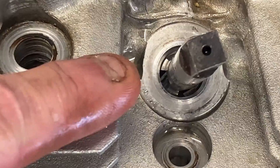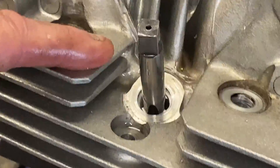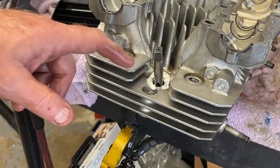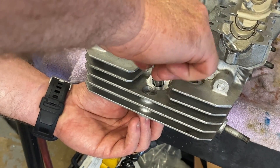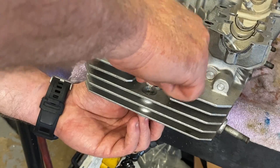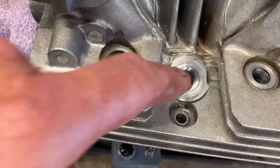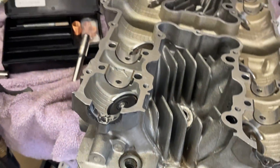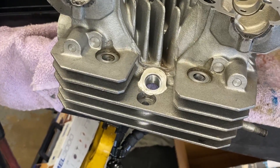You can see there's now a circle around the hole — we have contact on that outer surface. That's proof that your gasket surface for the spark plug is now where it needs to be. We can go straight through with the tool and take it out that way. There's your hole with the counterbore and the touch around the outside surface for the gasket — otherwise you can't be a hundred percent sure the gasket is going to seat squarely with the hole.